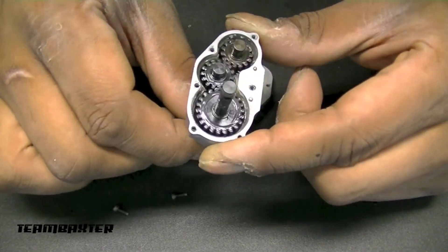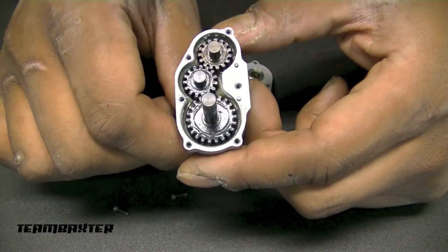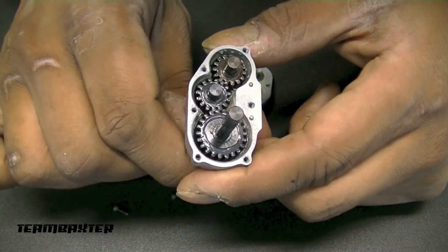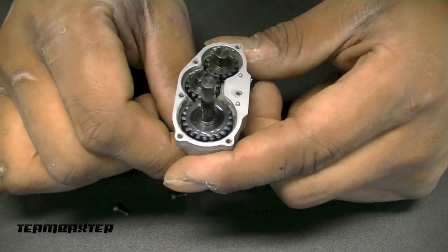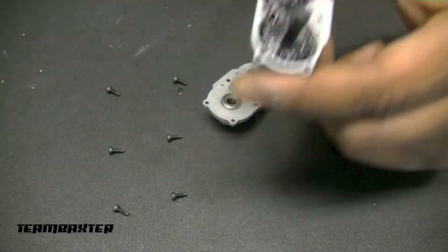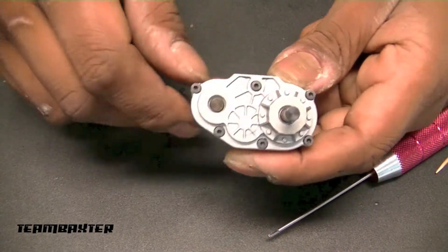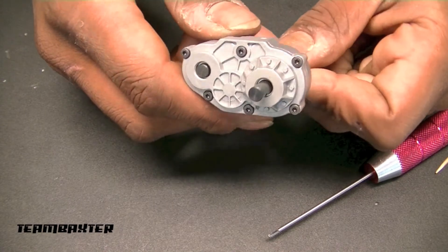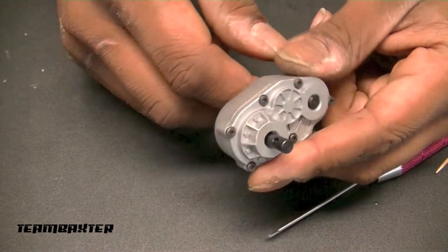I got the first piece apart and it's full of grease - 32 pitch gears in there looking nice, and it's got enough grease in there. I'm going to boost it up a little bit and close her back up. The transfer case has been greased and reassembled. I put some Loctite on the six screws that are holding it together because there was none when I disassembled it - just very little though, so I don't prohibit the screws from coming back out.